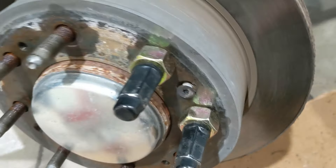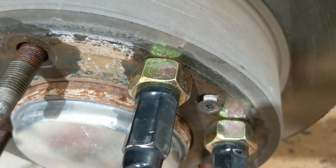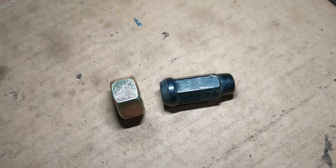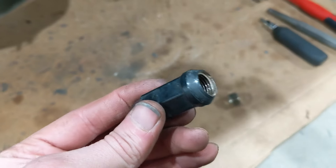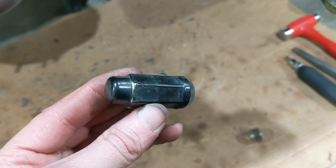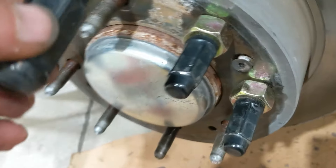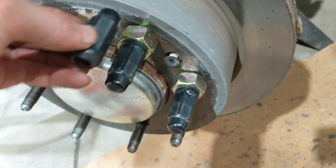What I ended up doing on this truck — and this did work — is I took the lug nuts and ran them into these standard three-quarter inch grade 8 coarse nuts. I did that because this truck has fancy blackout wheels with black lug nuts to match, and I didn't want to screw those up. If it were a regular truck with open lug nut holes and a flat back side, you could just flip the lug nuts around, add a few washers, and run them back on to put pressure on the rotor.